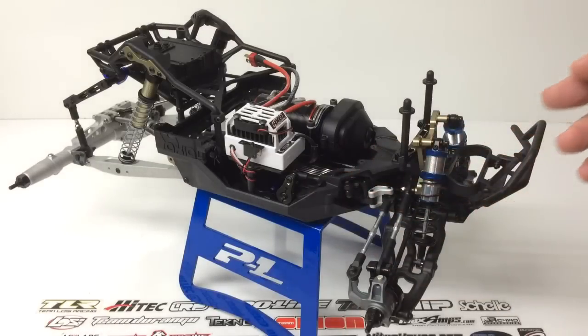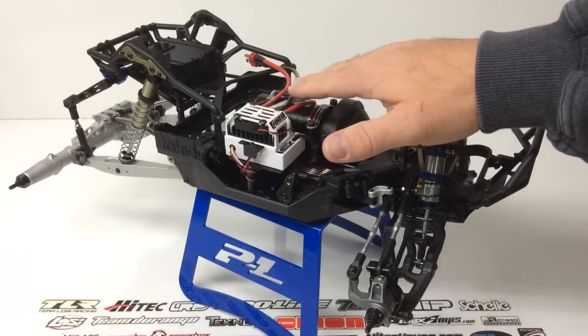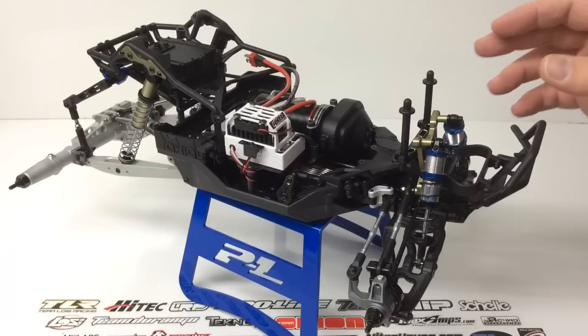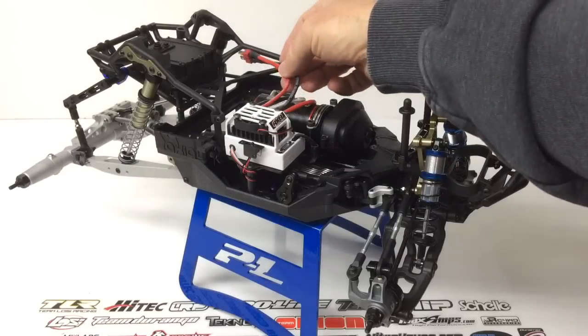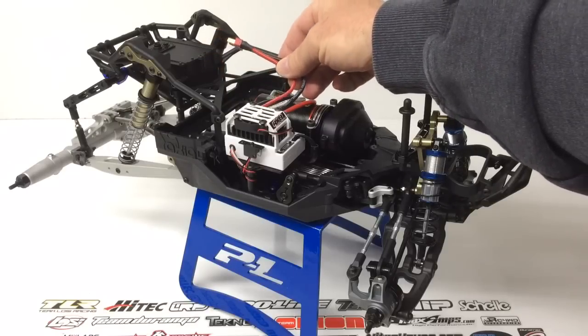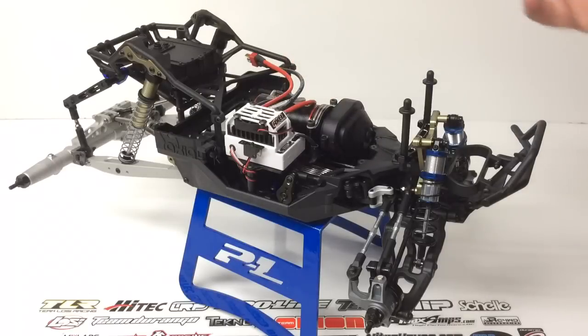The plate looks like it was actually made for the RX-8 — it fits it perfectly. Typically I like to trim down ESC plates, but this one fit absolutely perfectly. A couple of other things that were a little bit unique to this build: the ESC sits right next to the motor, so I turned the motor towards the driver side of the vehicle — the left side — for a little bit better cord management so the wires don't have sharp angles attaching to the motor. Another trick I always do is leave one side of my battery wires a little bit longer than the other to create a natural curve to the battery outlet, which helps keep everything from kinking and adds a little bit of longevity to the electronics.